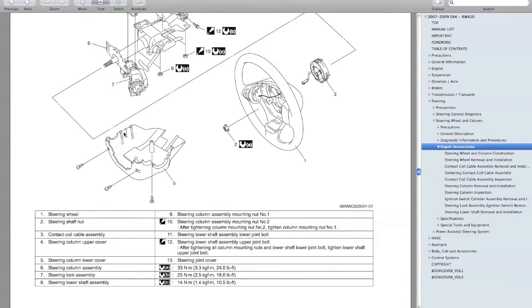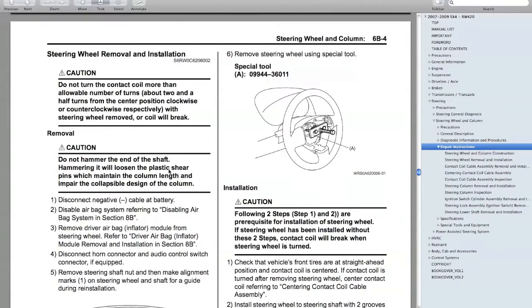Push in. There's tabs here and they hook on the other side, so push in and pull down. This side is easier to get off. You'll have to push in on it though, and then just using friction of your fingertips, pull down on the panel and it will unclip. And you'll want to have this panel off anyways to access the G346, I believe, the connection under there.